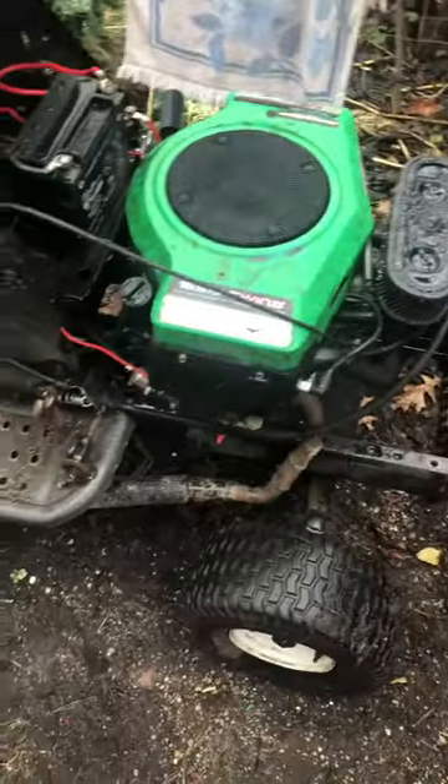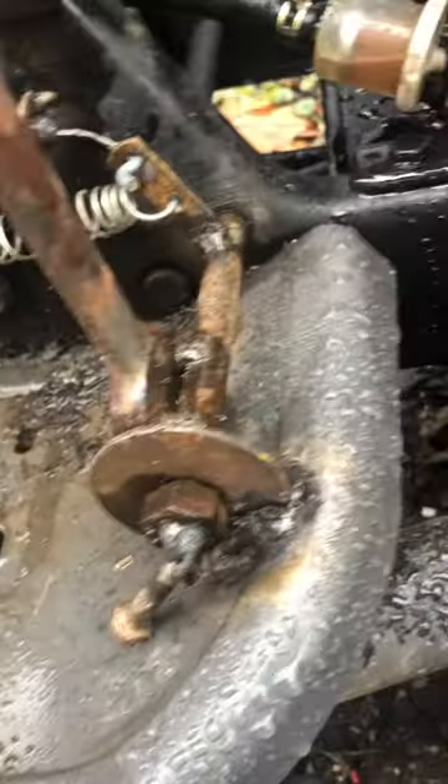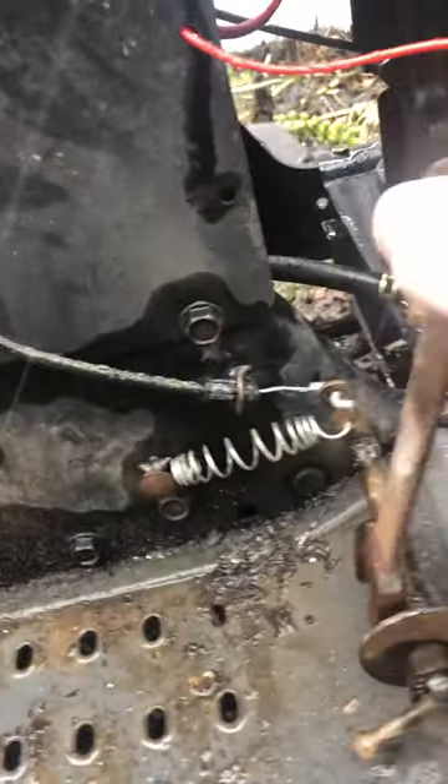This is how the throttle is hooked up on this mower. Down here there's a half inch bolt, a couple washers with a wrench at the pedal. This is a brake cable off of a lawn mower, just a washer. The cable comes up and clips right here to where another cable would have clipped, and it's hooked directly to that plastic piece with another spring to return it.